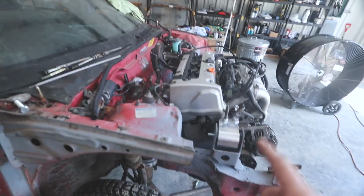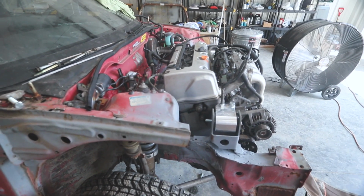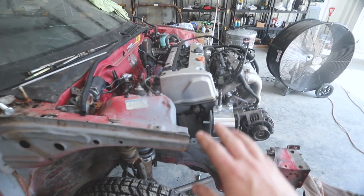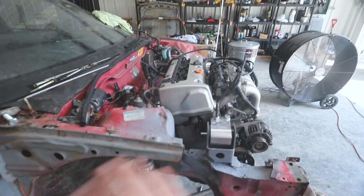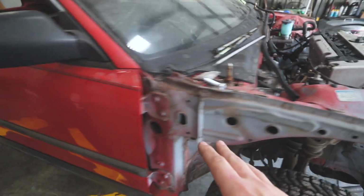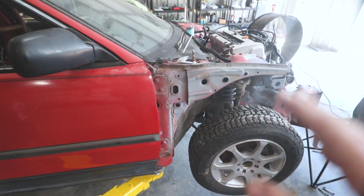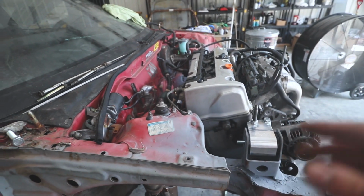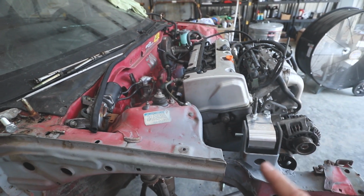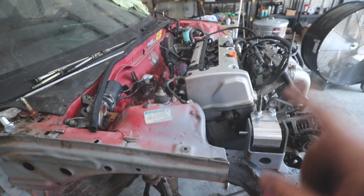Thank you, Chris. As it stands right now, if I was able to, I could put a battery on it, kick the ECU on, put a base tune, and I could probably get it to crank over. But I want to double check all my wiring and all my grounds before I do anything with the ECU, because I don't want to fry anything, especially something this expensive. I could probably get you a video of it cranking over, but for my sanity and my pocketbook and my sponsors, I'm going to wait.